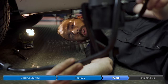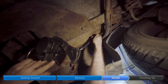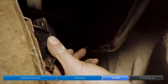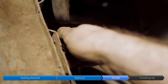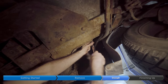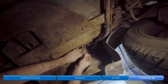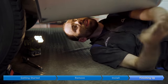Here's our new one — much nicer. Installation is basically the reverse of removal. First, lift it up into place. Take the 10 millimeter bolt and torque it to 89 inch-pounds. Then connect the hose, plug in the connector, and that's it.